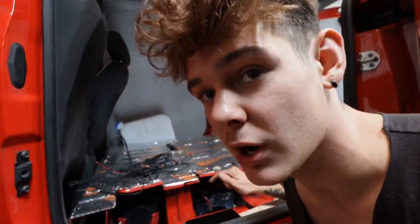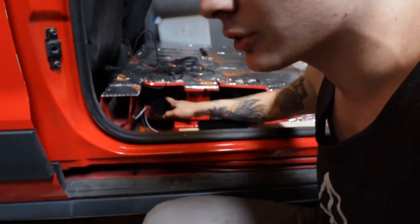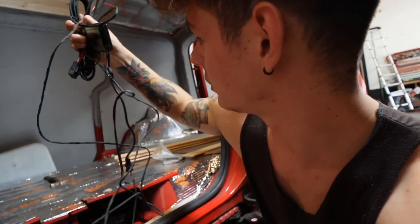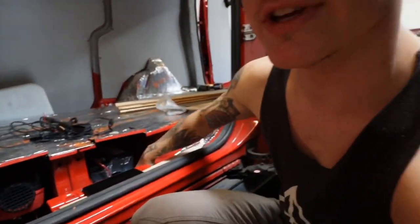We're then about to wire up using this cable, which comes off the diesel heater, which is under there, and we made a metal bracket for it to sit on. Bit of metalsmithing going on. We've then got the fuel pipe that runs all the way over the back underneath the side to the fuel can over there, which is going to be connected to the back of the bench when the bench goes in. And that's that pretty much set up. All we've got to do now is put this bunch of wiring in, which connects the diesel heater to this little junction box. And then that's your diesel heater set up once we've got fuel in it.